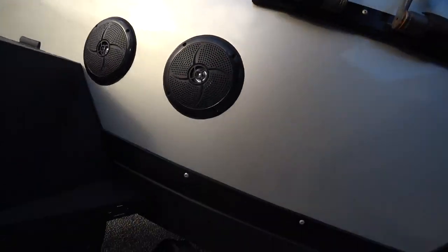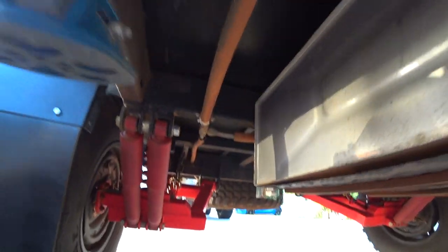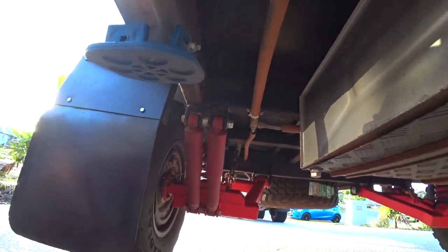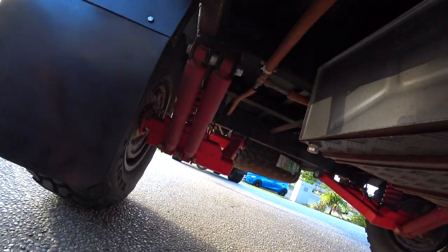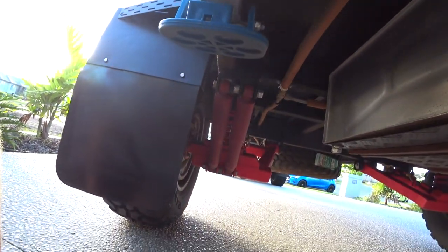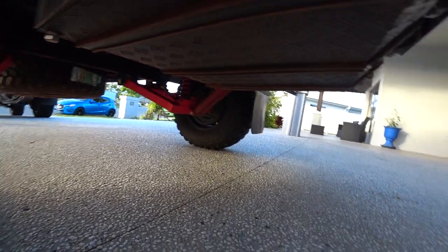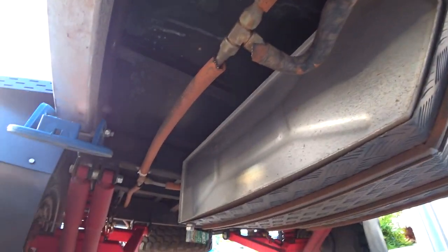Just get under here for a quick look. You've got a couple of things here. Spare wheel under there. You've got a drain to clear your water tank — you want to do that a couple of times. Here's the gas fittings — half inch with a rubber coating on them. There's your suspension — haven't had anything to do on that at all. When I first got it I got my local mechanic to rip the bearings and seals out and change them all to Japanese bearings, and obviously grease all the grease points. He was pretty impressed with the whole trailer. The bearings were Chinese but there was nothing wrong with them — they just didn't have enough grease in them. Make sure you do that — pack them full of grease. There were a couple of holes in the back tailgate that I put pop rivets in, and some holes underneath the floor that needed silicon.